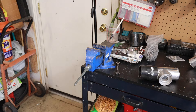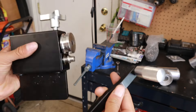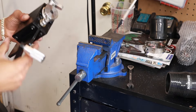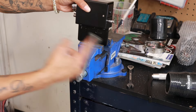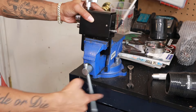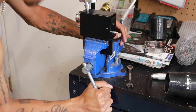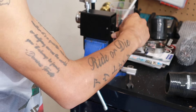The bead roller, ladies and gentlemen, will come in a box. It'll come with this roller piece as well as this handle piece. I'm going to show you guys how this gets set up right now. Essentially, you would take this and flip it in the direction you have the most room. You get the table vise a bit further in, set it in, and then tighten the table vise as much as possible. Then you go ahead and grab this — it just goes on the very end right here, just like so.